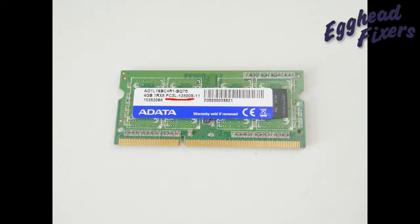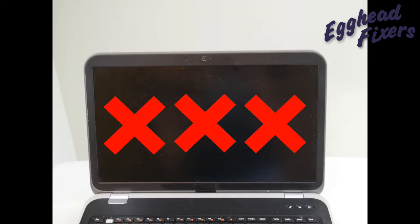To continue the troubleshooting method: if you find it isn't your RAM, the next thing you're going to need to do is try connecting it to an external monitor to see if it displays to it. If it does, then you know it's most likely a problem with your LCD or your LCD cable. The next thing after that — if that does not work — you need to try to replace your CMOS battery. It's less likely than the RAM, but it does happen. You can refer to the video down below, which will show you how to perform a BIOS reset involving removing the CMOS battery. Oftentimes when a CMOS battery has gone bad, it can cause these kinds of display issues.